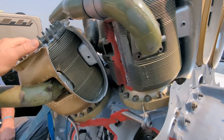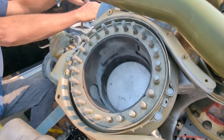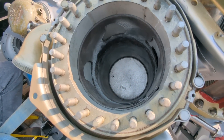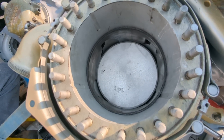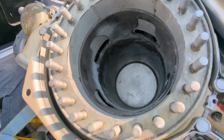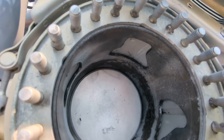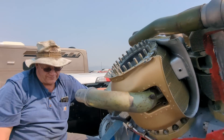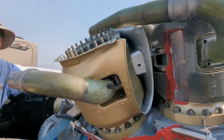So let's try to get our heads wrapped around how this sleeve-valve works. Brian's going to turn this — watch the sleeve-valve motion. See the piston going down? See the sleeve-valve coming down and rotating at the same time. See the ports open up? There are multiple intake and exhaust ports in here — three intake and two exhaust ports. So how does that sleeve-valve get actuated?